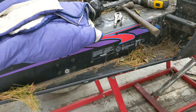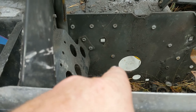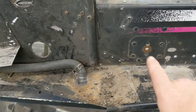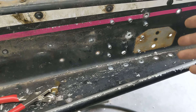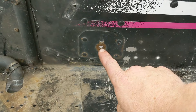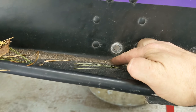I have a template basically, and I did some measuring first. I measured from where the drivers go through the bulkhead here to the first hole — this one happened to be 12 and a quarter, this one over here 12 and three-quarters. That's close enough, I'm not even going to mess with that front hole. The second hole from there back was like 25-28 inches or something, but it needs to be 23 inches from center to center. I already put this side in — I wanted to do one side to make sure everything was going to go good. I checked over here on the Storm with the Extra 10 in it — measured from here to here, 23 inches.